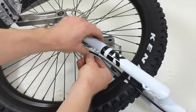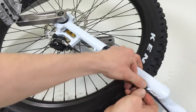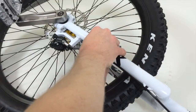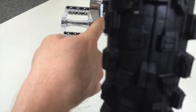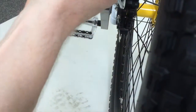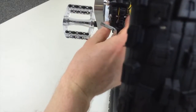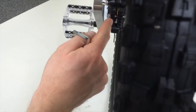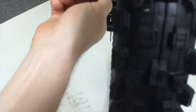Clip the little cable clips on the hose. So the disc brake is now mounted. To adjust it, have a look at your brake. In this case, you can see that the brake pad on the left side is actually touching the disc. To adjust it, just open the screws a little bit, and you'll be able to move the caliper to have a proper distance at the left and at the right of the brake pad. Then just fix it again and it'll be rub-free.